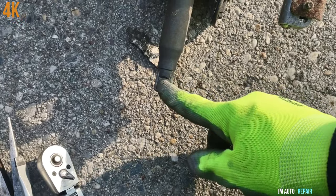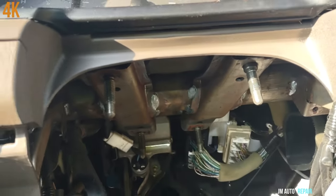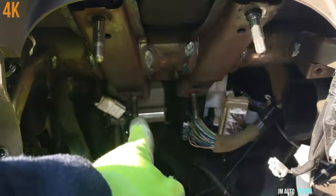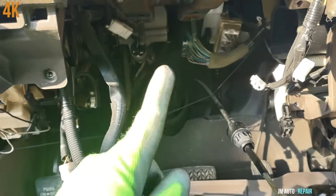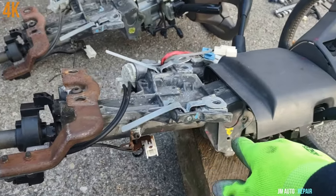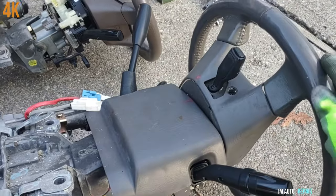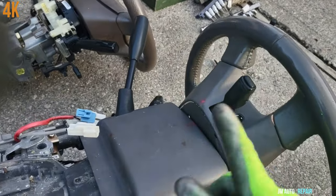This part here stays up and that's how it goes straight. Now that I don't have the steering column here it's easy to see the bolts — right there and right there. Make sure you don't forget to transfer anything from the old steering column to the new one, otherwise you'll have to take it all out again. That's the one that came out and this is the one going in. I put two alignment marks here — these marks line up so I can install it straight.